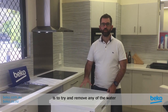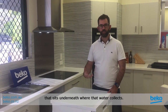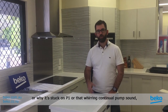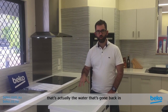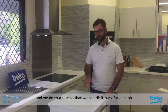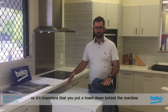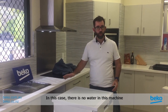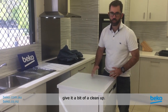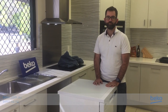The final step is to remove any water that has returned back to the dishwasher. If you found a blockage, water will have run back into the dishwasher and collected in a bottom flood pan underneath. That water is what activates your E01 error, or causes it to be stuck on P1, or produces that continual pump sound. We've taken the dishwasher out of its position so we can tilt it back far enough to get the water to run out of the flood pan. Put a towel down behind the machine because you don't know how much water will come out. Tilt it back slightly and once all the water has run out, clean it up. That should allow you to run another wash, which will hopefully run smoothly and get you washing your dishes again.